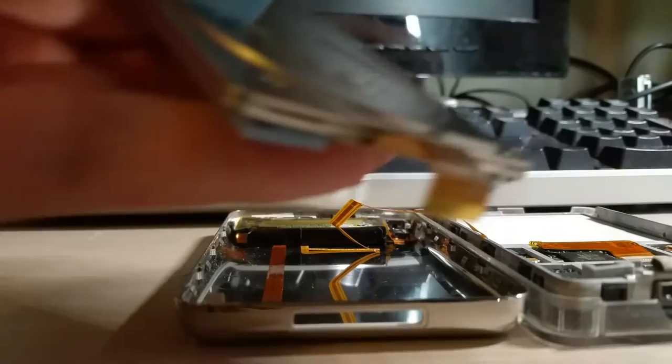Now what we're going to do is harvest the rubber guards and this foam material. There's some double-sided tape — you might have to pry it, but it will come off. This is the original 30 gig drive. There's a ZIF connector on here as well, so lift that up and very carefully wiggle the ribbon connector off. Then you can close it, recycle it, whatever — I'll be keeping it as a spare 30 gig drive.